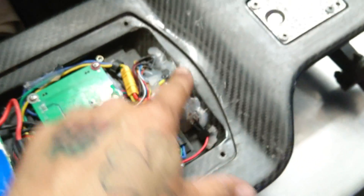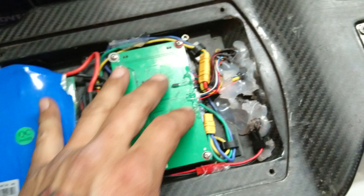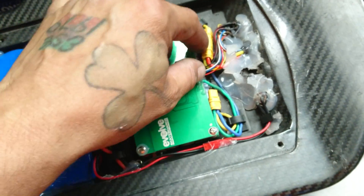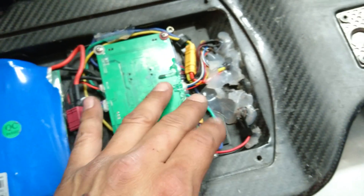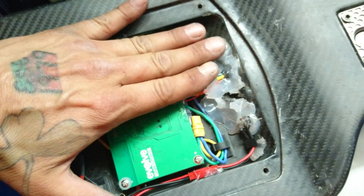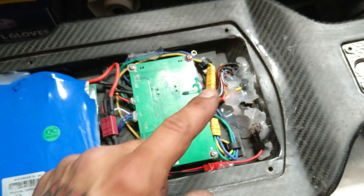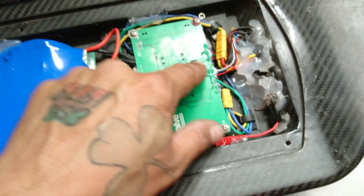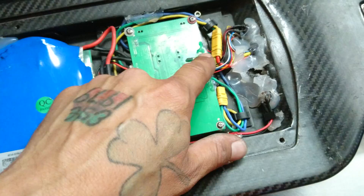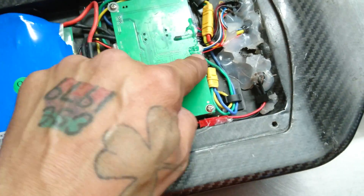It comes through inside into here. I use the hot glue because I had a lot of trouble with road vibration — the clips were coming loose. So as an extra precaution I glued everything and it's all in place. You have to be very careful with the hot glue gun if you decide to do this. If you get hot glue on your board, be careful when you pick it off because you can pick part of the board off.